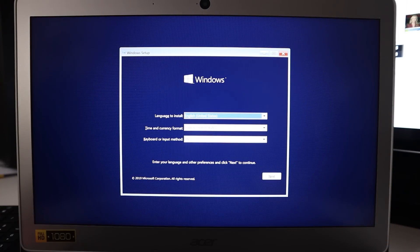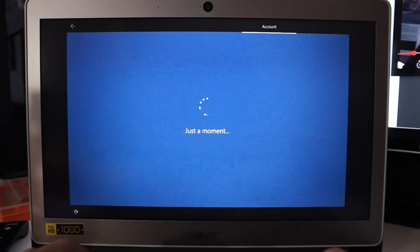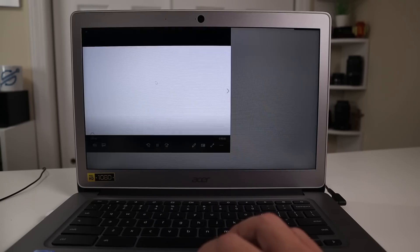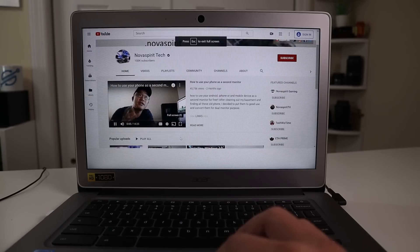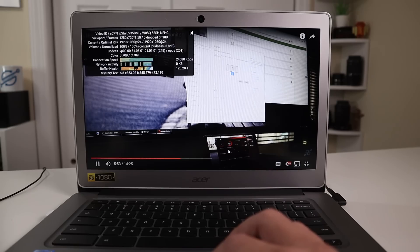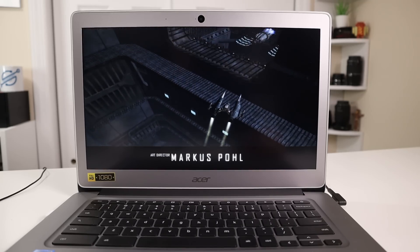At that point, stick in your Windows USB and install it like you would on any regular laptop. I'd recommend Windows 10 Home because it's lighter weight, and there are steps to compress the installation. Keep in mind the touchpad doesn't work after installing — that's specific to this model. Coolstar has all the drivers, plus key remapping since there are no function keys on top; it maps them and keeps media keys if you hold Control. I've been using this for a couple of days and really like it — running a low-end device on a bigger screen is very comfortable, and there's no fan so it's practically silent.